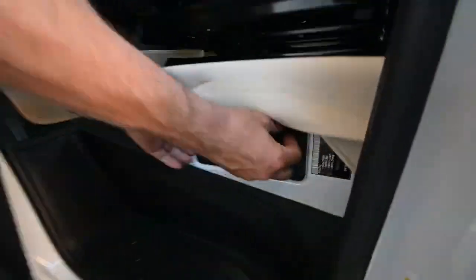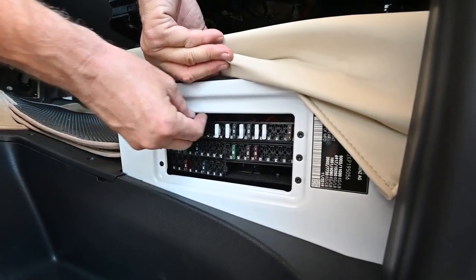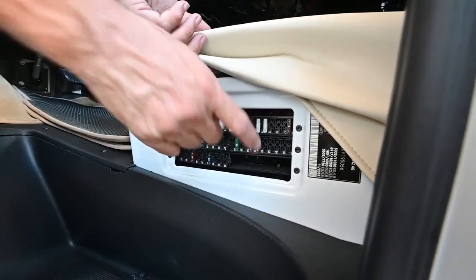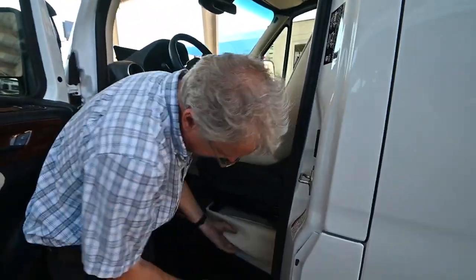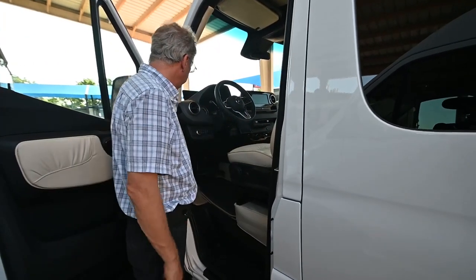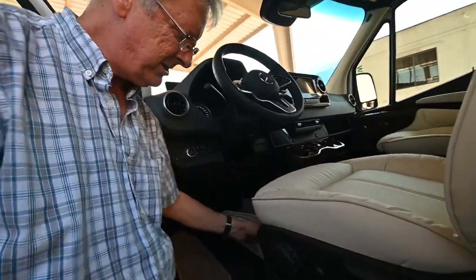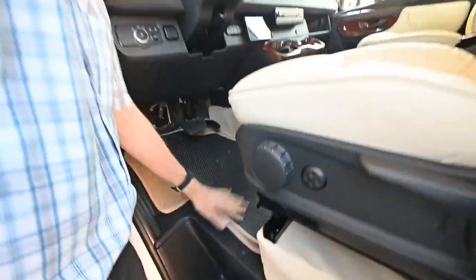Let me show you some fuses. I've got chassis fuses right here - these are on the Mercedes side. You'll find these in your Mercedes manual. There's also some on the passenger side in the floorboard. All these are in the Mercedes manual and they'll tell you which light they go to - blinker, horn, everything like that. The battery is actually located here; this is where the chassis battery lives - underneath this cover below the driver's footboard.